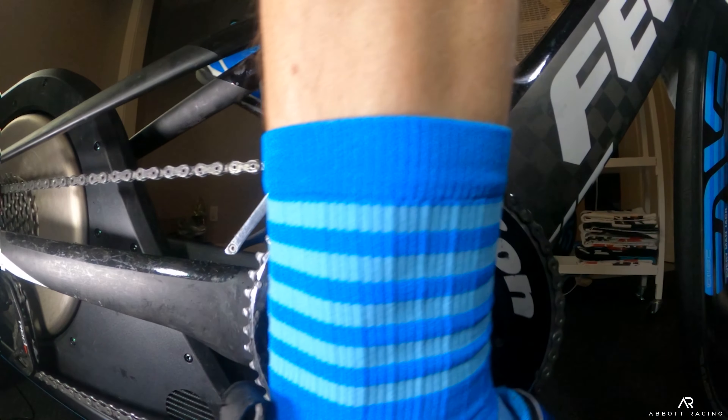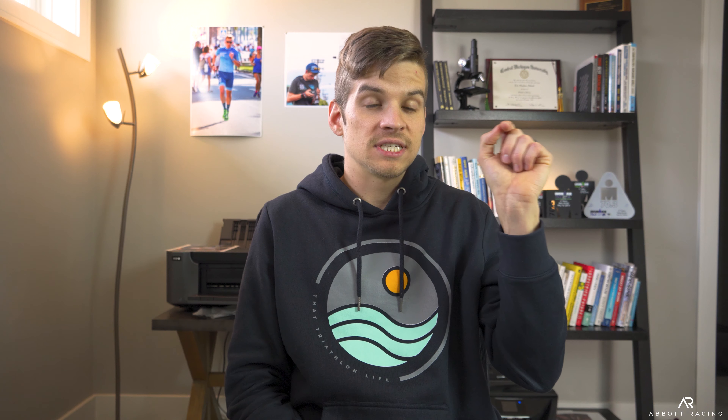The main thing you need to be concerned about is the transition from chain links at rest with their neighbor to moving in relation to their neighbor. Take a look at this slow-mo video of me riding my bike. You can clearly see the links are at rest with each other as they enter the top of my crank. That first link engages with the crank and starts to rotate as it moves around the crank while its neighbor is still at rest. That creates movement in one link that is not present in the other, and that is the primary cause of chain friction. Friction Facts actually did the math on that and found that at a cadence of 90, you're going to have 40,000 of those sticking points per minute.